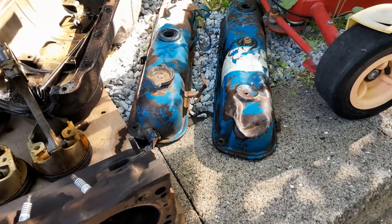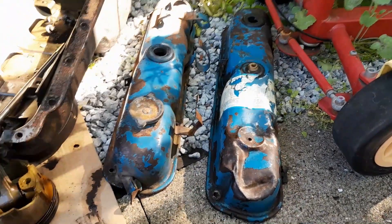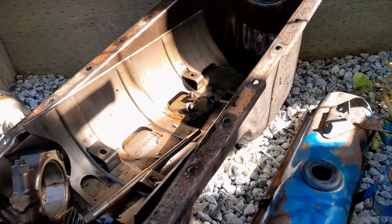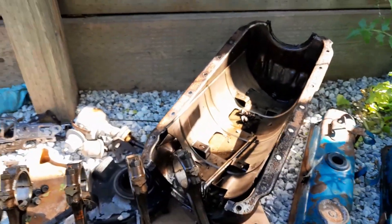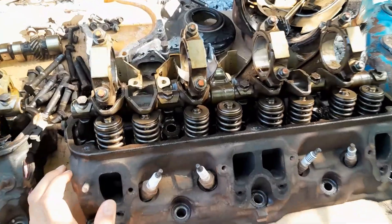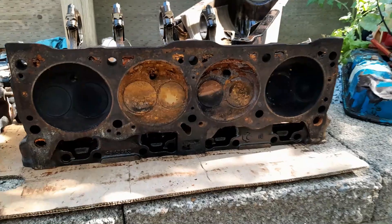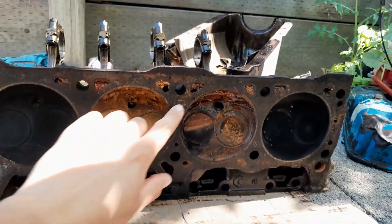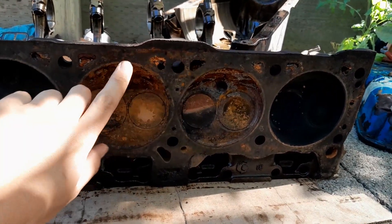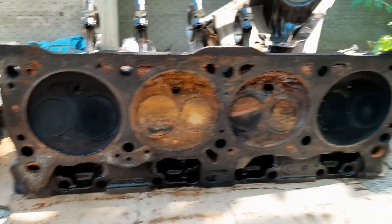There are little annoying things we've got to fix. First, these valve covers are not in the best shape. Second, the oil pan is all smashed in underneath. At first glance the heads don't look that bad — no obvious cracks — but looking underneath they're not too pretty. There's rust flakes stuck in there; we're probably going to need new valves, valve seats, and a valve job.